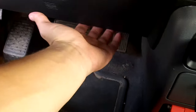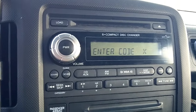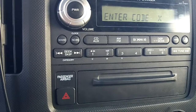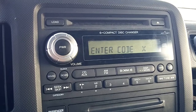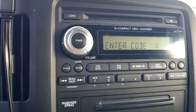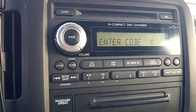I'm going to put them on the bottom — I'll do a video on that later — but I unplugged the fuse to the radio in order to wire it for the LED lights, so I don't get power for the LEDs whenever I turn the battery on. The problem with that is, apparently in Hondas when you unplug the fuse and unplug the radio, it goes into radio theft mode, so you have to find the code in order to reset your radio.